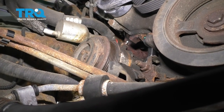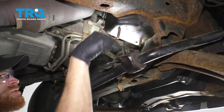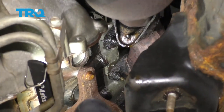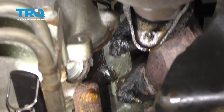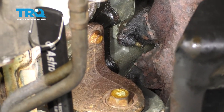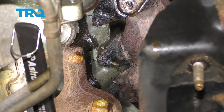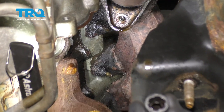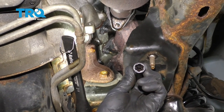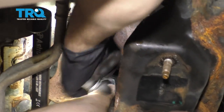Now let's carefully lower this and put it down. We're just gonna disconnect our crank position sensor. If you wanted to, you could remove the nuts that hold your sway bar up to the frame — that's gonna give you more room. With the starter out and the AC compressor out of the front area, you have a nice clear view of all of your lower mounting studs for your manifold. At this point, it's a good idea to go ahead and heat those up gently and then spray them with some penetrant. After that, if they look as though they're rotted, more than likely you're gonna have to use a twisty socket. As you bonk this on there, it's gonna twist on a little tighter, and then as you continue to try to loosen, it's gonna grab more and more. Let's go ahead and remove all these lower nuts.